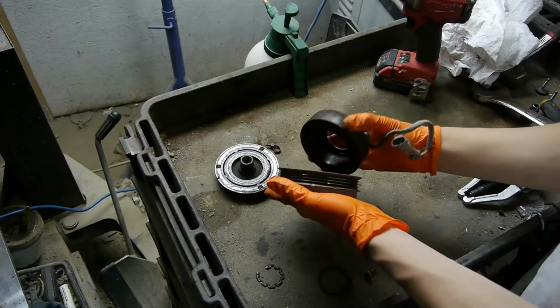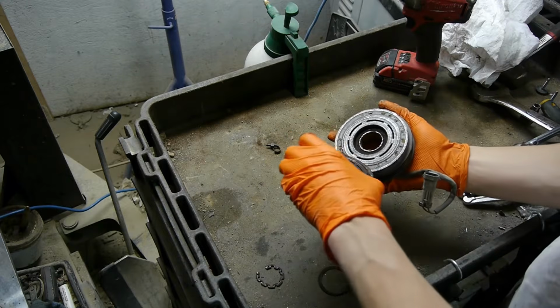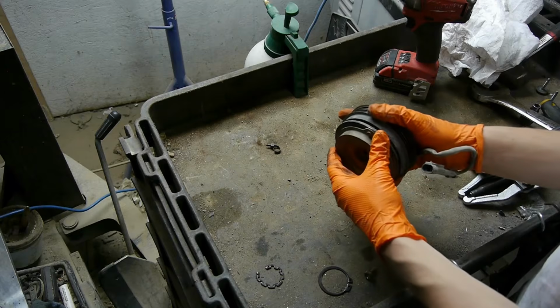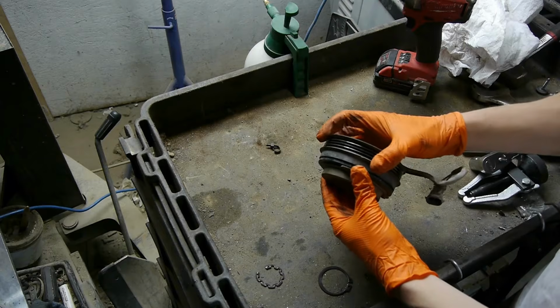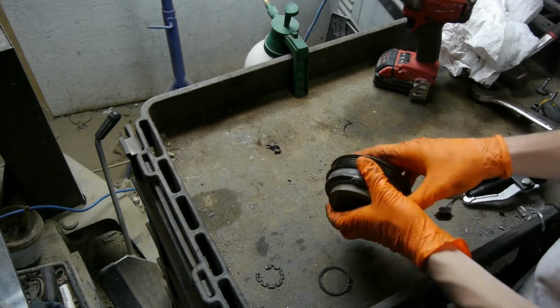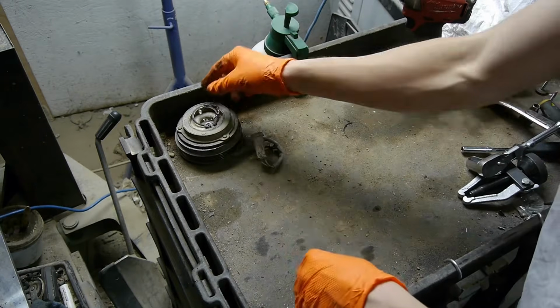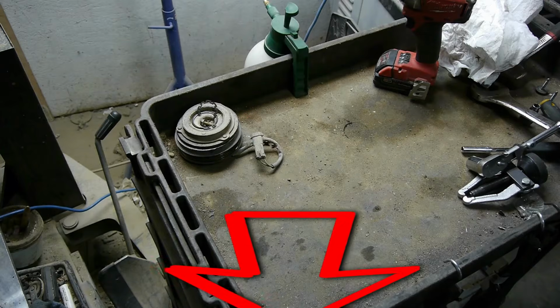So here's our coil that sits in the pulley. This hub that is attached to the AC compressor shaft is on top of the pulley. When the coil receives 12 volts, it magnetizes and pulls the hub toward the spinning pulley and makes the AC system work. The coil was the broken part. If I ever make a video on how to diagnose an AC clutch, I'll just link it right here and in the description.